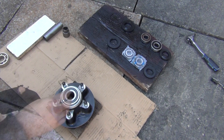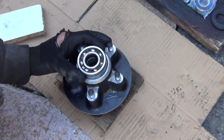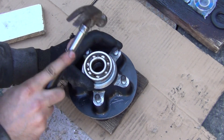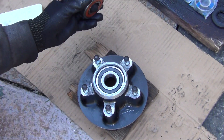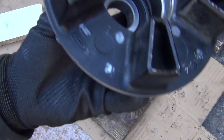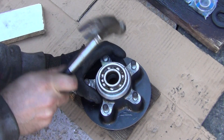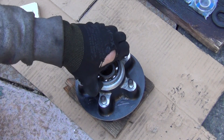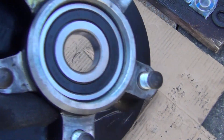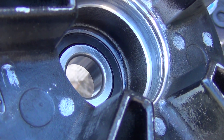The old one goes at the top. It's actually quite deep now but not fully inserted. You can keep checking it from the other side and you'll see there's still a bit of space between the bearing and the hub. And that is it — you can hear the sound has actually changed. It's more like a metallic sound because the bearing is fully inserted and there is no gap between the bearing and the hub.